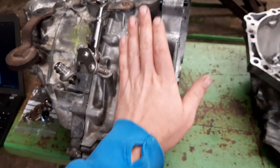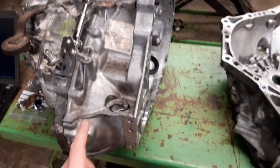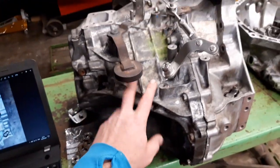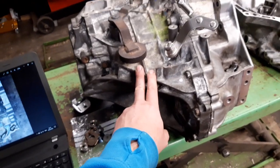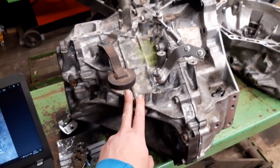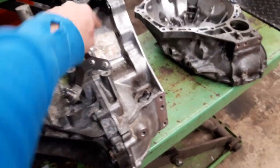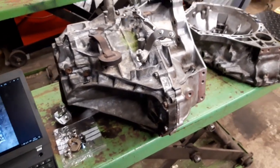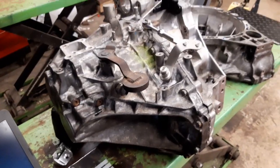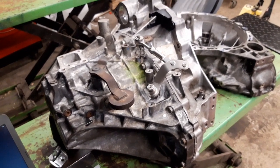You need some sort of adapter for that, and you need to import a case from the US or buy a brand new one. If you try and use a non-USDM EB60 or EB63 — whatever gearbox — it will not fit without a bell housing and modification to the linkage kit. Anyway, good luck with your 2AR FXE conversions. Bye.